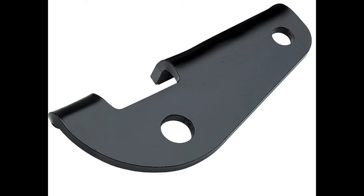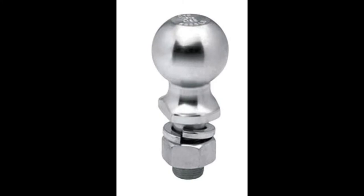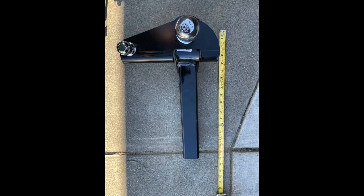Our trailer hitch had to be flipped to the other side in order for it to be level with the Tab trailer. So I ordered this sway bracket that you put over the trailer hitch mount itself and attach it, and it made it flexible where I could have the ball on the right side for the sway bar versus the left side. You may have to order your ball hitches separately, or they may come in the kit you already order. I had to order mine separately because I put it together from scratch. From the ball mount to the locking pin onto your Jeep or vehicle is 13 inches, which was perfect for the Wrangler setup.